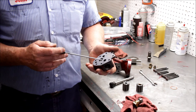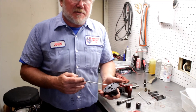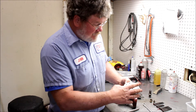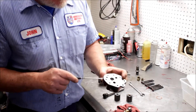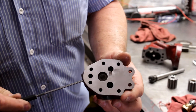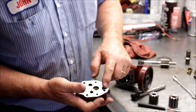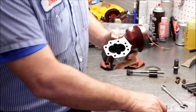That stabilizes the oil pressure, and the oil pressure ought to be about 65 pounds — that's true on all MGs. Once the oil is available up here, it loops and then there's a cross drilling through here. Down inside you can see the cross drilling, which then becomes available through the hole on this side, and runs into the hole here.